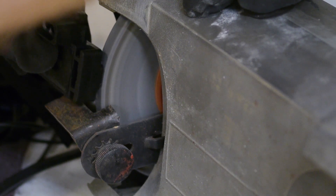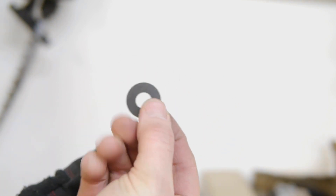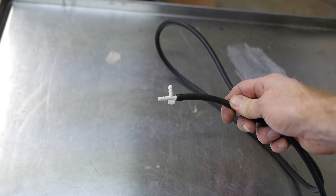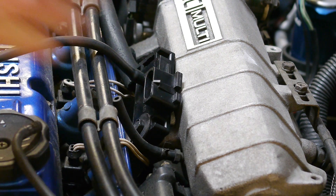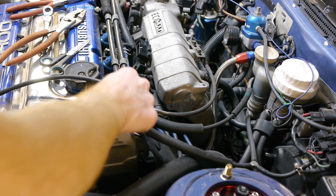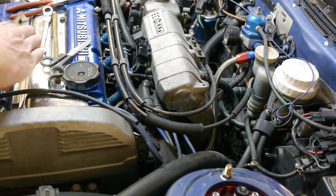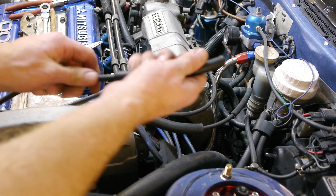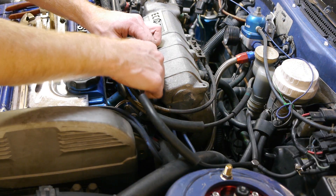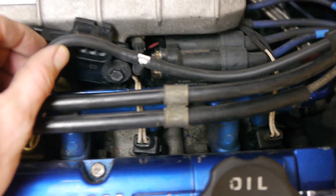Be really careful not to let it get too hot or damage the sensor — slow and steady is best here. There we go, perfect. I'm also going to add a rubber washer to help dampen any vibrations on the sensor. Next we pick out some hose and a tee fitting and start plumbing everything up — connect some vacuum line to the GM MAP sensor, a short piece to the manifold, then splice in a tee connector. This particular piece of line is pretty old so let's replace that as well. It was really jammed on there and a bit of a pain to get off. There was also a shield/covering thing on there — I don't know what it's meant to protect from specifically, but we might as well reuse it. There we go, tucked in there nice and snug. Now all we have to do is plug in the cable.